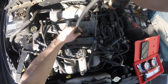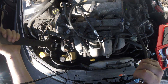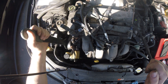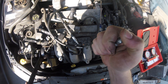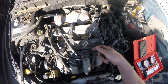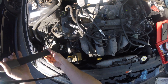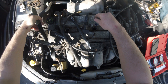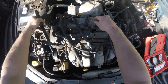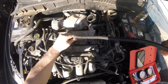I'll show you, if you can hear with all this noise outside. Put our hose back in. Now listen — the air coming out is the compression being built up. Now that was just to show you guys. We want to bring it to top dead center, just till it comes up. Right there. Now I'm not going to hold this — I'm going to throw the car in sixth gear, because if we put air in here it'll move the engine. Put our hose back down in there.